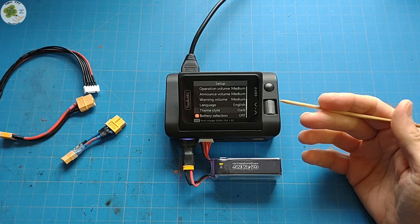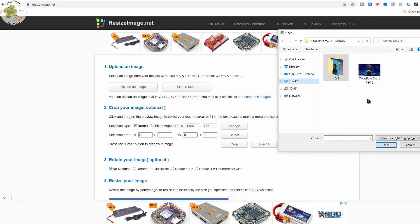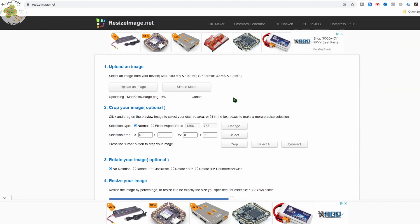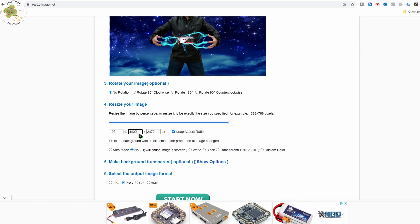The M9 has lots of features, but let me show you how easy it is to customize your startup image and audio files. Just grab any image you want — the M9 charger supports a max image size of 320 by 240 in BMP file format. The app I use is resizeimage.net. Upload the image you want, change your pixel size to 320 by 240. If you notice that typing in 240 makes your other dimension exceed the max pixel size, just make sure the highest dimension is within the M9 charger's max image size.